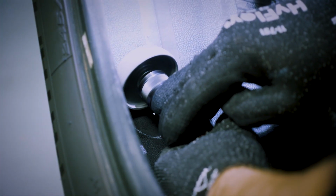Lightly buff the repair area using a low-speed buffer with an 18 to 36 grit buffing rasp. Make sure to not use a buffer that exceeds 5000 RPM, or it may scorch the inner liner, which could cause a repair failure. If at any time during the buffing procedure, the radial plies or body plies are damaged or exposed, the tire should be replaced.